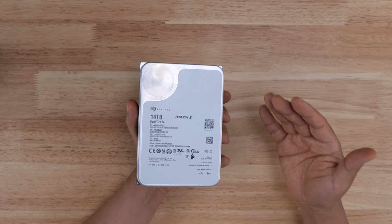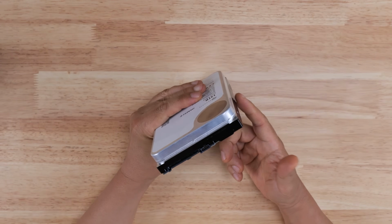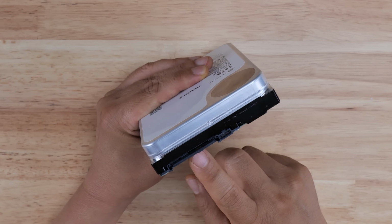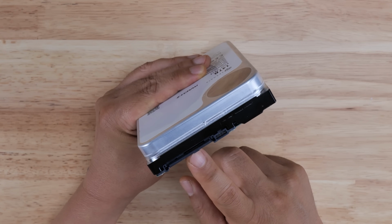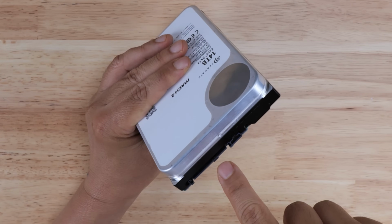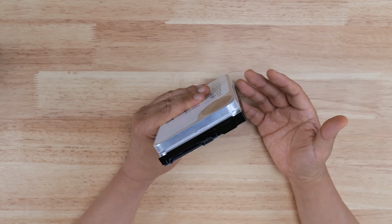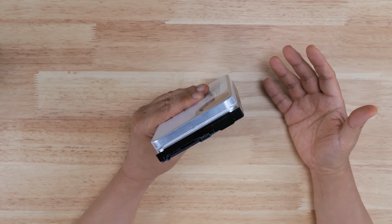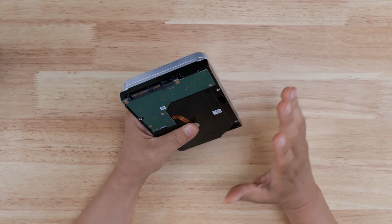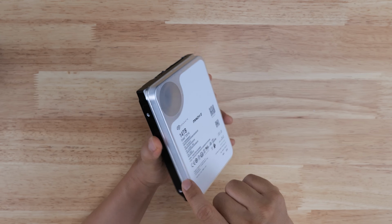Now, the last part is what I found somewhat confusing. They mention dual channel access, and this immediately made me wonder if they're talking about the secondary SAS port on these SAS drives. You see, SAS drives have a primary data port, which is right here, and a secondary data port, which is right above here. And this is often used in dual SAS expander setups to enable redundant paths, and in some cases of SSDs, increased bandwidth to the drives.